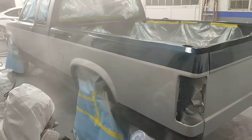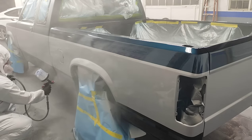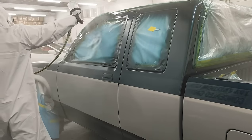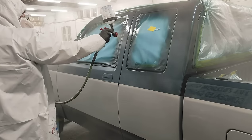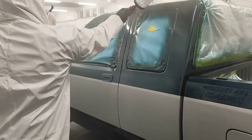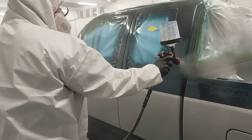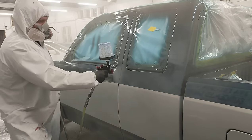We do have other products out there in clear coats that you can smash on full wet from the first coat all the way to the last coat. The SMR 1150, perfect example. First coat, I smash every single coat on full wet. But this clear is just slightly different. I would suggest playing around and finding a specific clear that works best for the way you like to spray and the way you like to do your specific project.